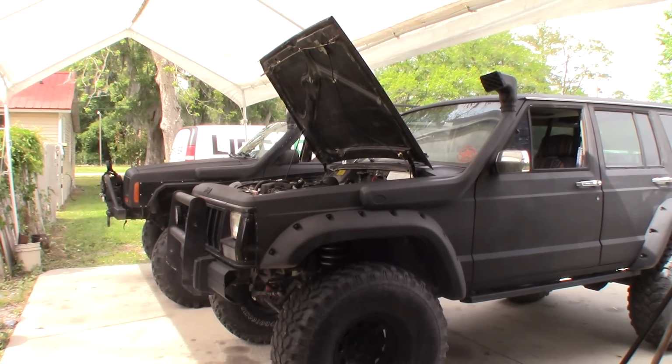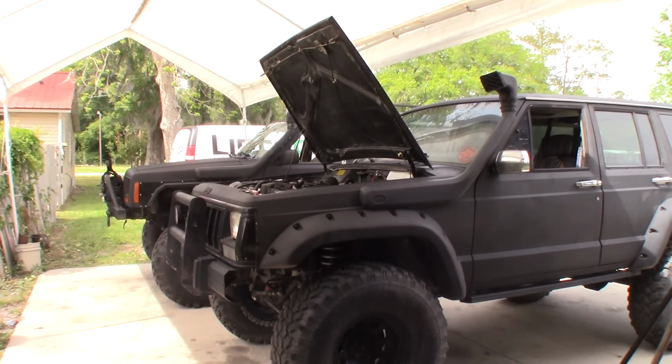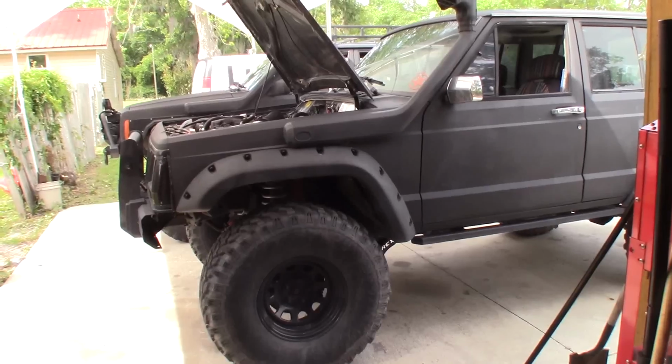It's just when your drive shaft gets your slip yoke in your front end, how I told y'all to check that. If it gets stiff and it won't push in and out, it'll wear your pinion bearings out quick, pushing and pulling on them. Let me take y'all off here and I'll show you what we got to do to this thing.